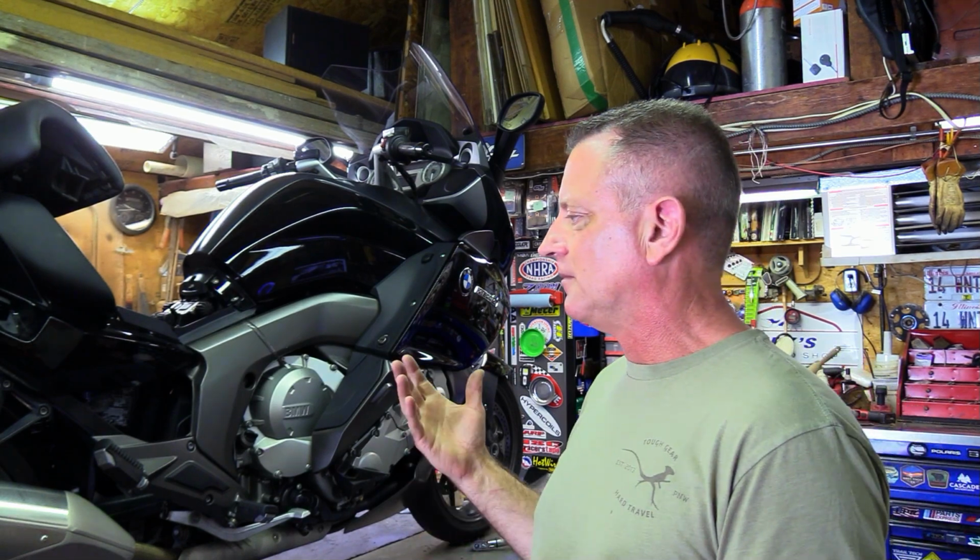I think what happens is these pumps are made with such tight precision that they're literally on the edge of not running all the time. They're not overbuilt pumps, not like trash pumps. They are very delicate little pumps, and if the slightest bit of dirt or corrosion gets in there, it will lock up the little impeller, and then it doesn't run again. So I'm going to try to get this one to run. If I can't get it to run, I'll just swap it out.